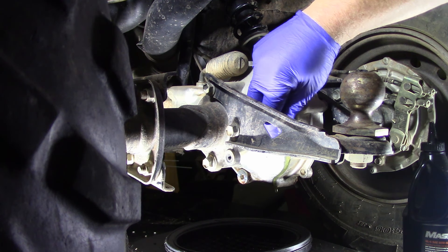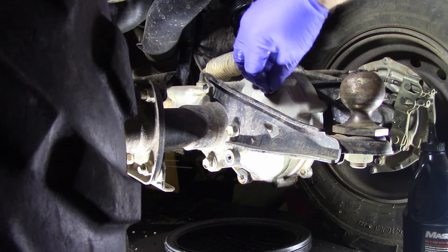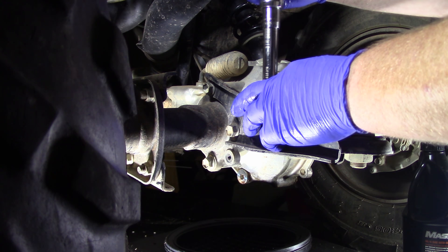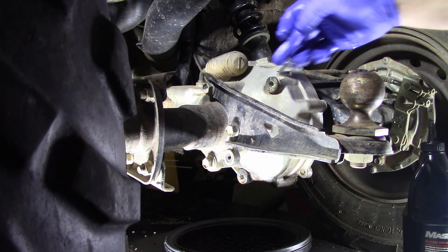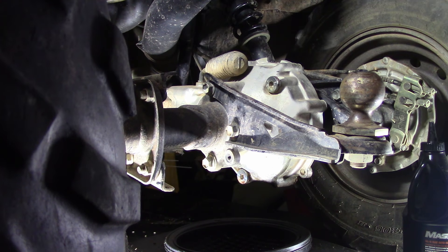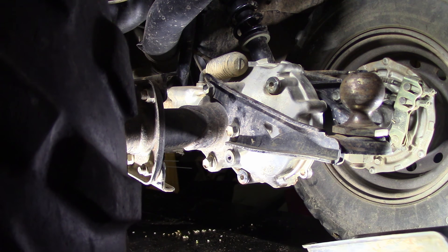Go ahead, put your bolt back in and tighten down. Now put in the top service plug. Now you are ready to torque: your visual service port is 84 inch-pounds or 7 foot-pounds — go ahead and tighten it down. Your upper service is still 24 foot-pounds. Now remove everything around it, and make sure you've checked for any visual drips.